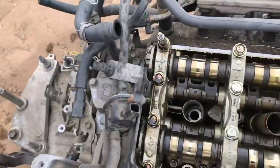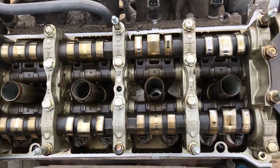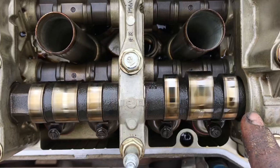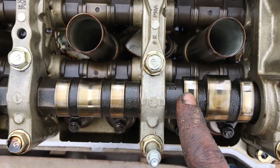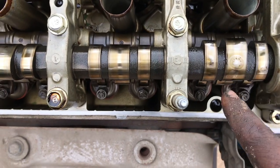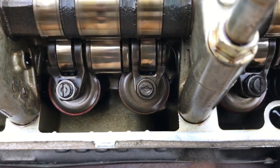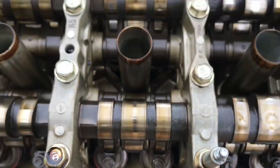For some people who don't know about the VTEC lobes — this is a three-lobe setup. So this is lobe one, lobe two, lobe three. This is your actual VTEC lobe. So when you go on the VTEC, the pins lock up and run off of this lobe. That's basically your VTEC.